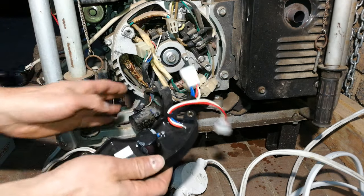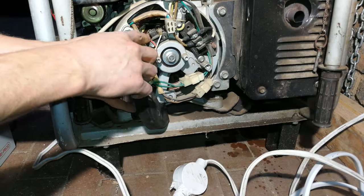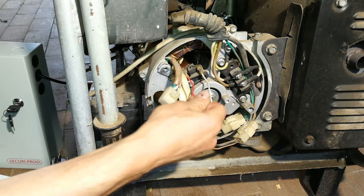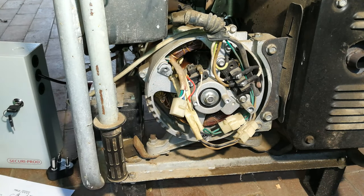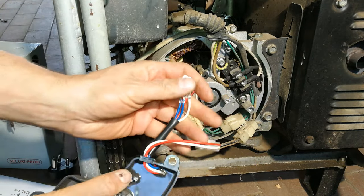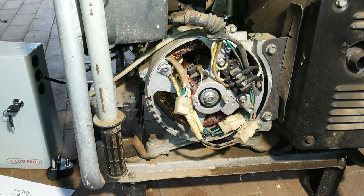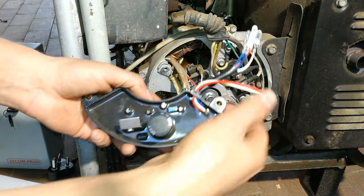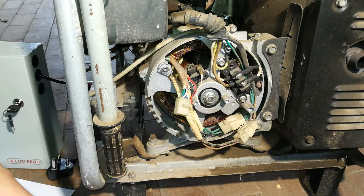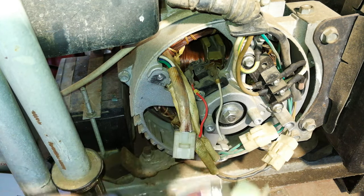I've matched the power output at five kilowatts and got a new regulator. It's almost a plug-and-play device — you just unplug this, and unplug that. On mine it has terminals so I'm going to cut them. I've cut these two wires, and the reason is because the new regulator comes with a plug that does not fit over the old plug. The company who sold this made it specifically for their own generator, so it's a little bit different. I'm going to retrofit it — I'll take the plug from the old regulator and put it on the new regulator.